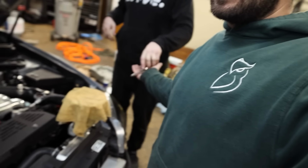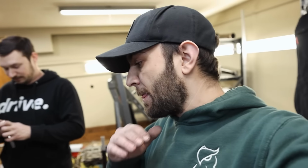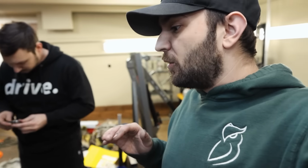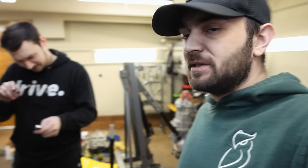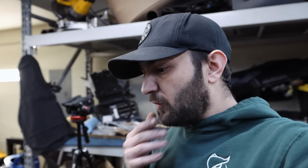I don't know, where did the quarter inch tin go? Oh, it's right here. So, Matthias and I have gotten everything reassembled again. We have a brand new clutch, brand new flywheel. We did not force the engine and the transmission together when we put this thing on. We got it so it aligned and just kind of slid together, because that way we know everything's aligned properly.